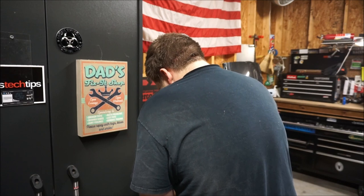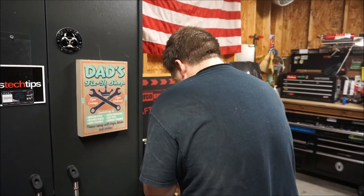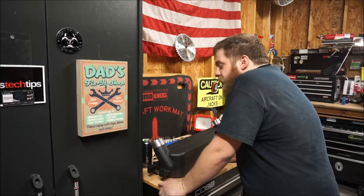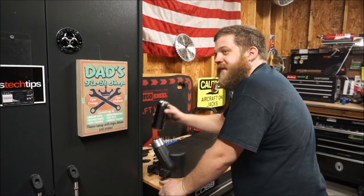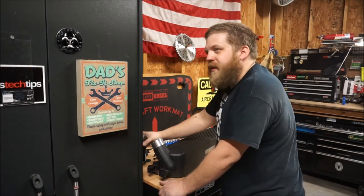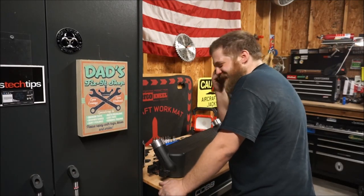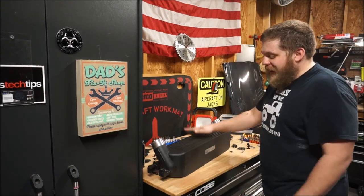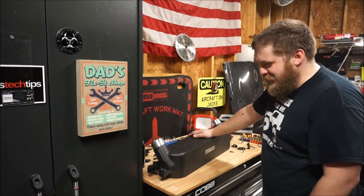Did you do some data logging previously? We could do a comparative. Under the same amount of boost, look at the charge air temps. Yes. That's exactly something that I would have done. Fair enough. I hate to Monday morning quarterback your video here on your own channel, but probably should have done that. The point is before you install the intercooler, you want a data log. You want a data log to make sure the intercooler is doing anything.